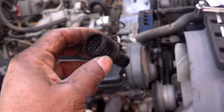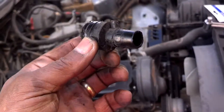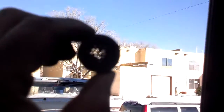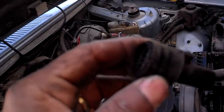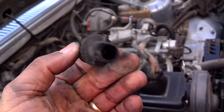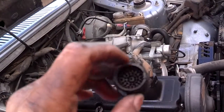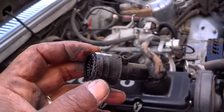This is the Redblock PCV system. I worked the flame trap housing off of the hose and I can see daylight through it, so it's not totally clogged. But I believe I do have another one, so I'm going to replace it and get this housing with the nipple so I can get this vacuum hooked back on right. I'm going to clean this up, replace this plastic piece, put that back together, and try to work out a way to get that vacuum hose hooked back up.